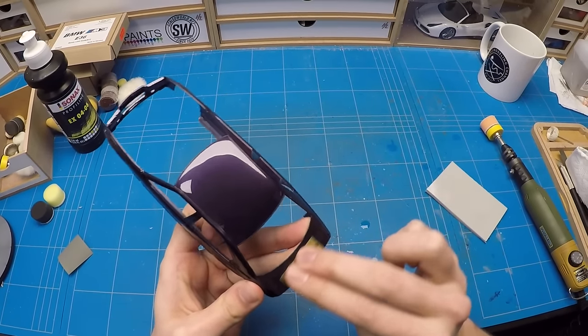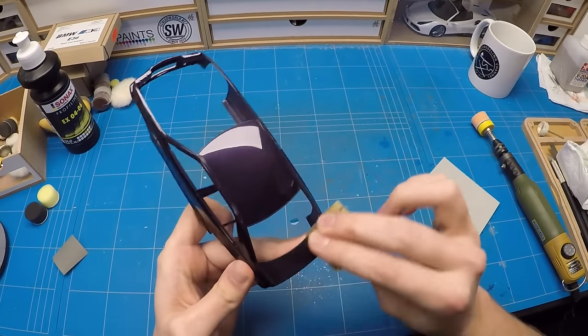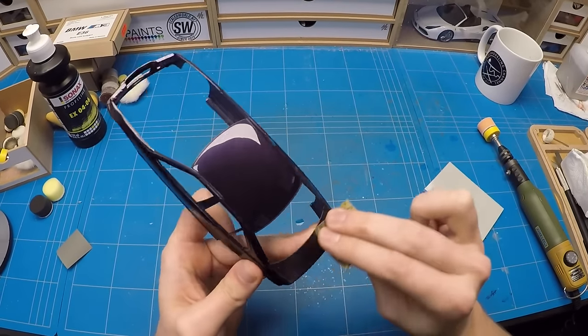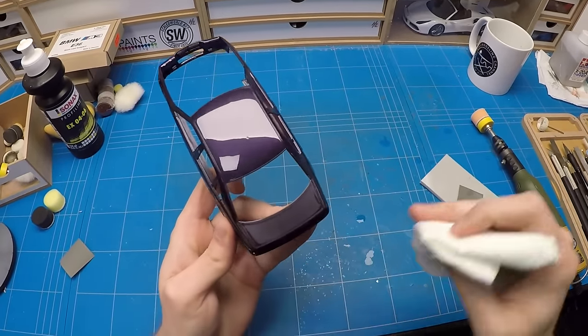I decided to give polishing a try, as the last couple of builds I've already just sanded it down and applied more clear, and figured polishing would be a nice challenge as well. So I just took out some 3000 grit sandpaper, started wet sanding all of the areas that were affected with the orange peel, then carefully started the polishing process.